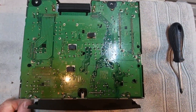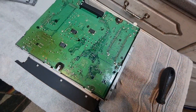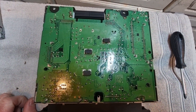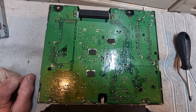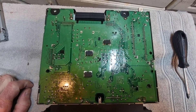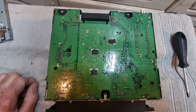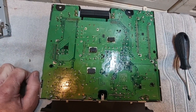What I've got to do now is unsolder this board from the actual casing. There are some solder points around the outside that all have to be desoldered, which is a bit of a rubbish design. I'm going to do that now, and when I've done that I'll come back and show you the resistors we're going to have to change. Apparently there are four resistors inside here that you have to change - replace them with a couple of 10Ks and a couple of 100Ks.